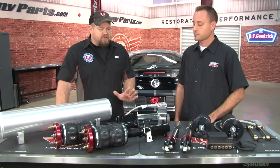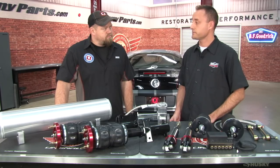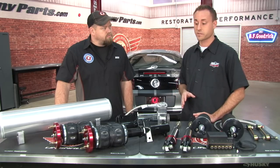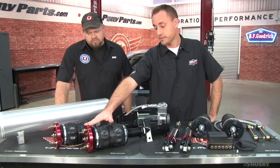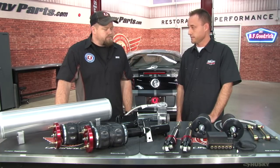What kind of adjustability do you have in your shocks and struts? They are 30-way damping adjustable, so you can really fine-tune it for a stiff ride or for the track. Going drag racing, you can stiffen up the rear and lighten up the front to get good weight transfer. We've also got adjustable camber plates — these will go to about negative three degrees. And this is a complete bolt-in strut assembly; I don't need any pieces off the factory one.